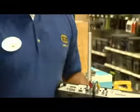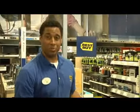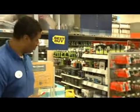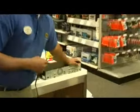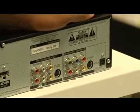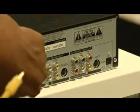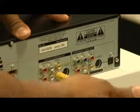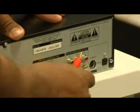After you've taken this step, you're going to then want to take the other end of your cable and hook it into the back of your VCR via the inputs. You're going to want to be careful — on the back of most VCRs there are input and output plugs, so you're going to want to locate the plug that says input. Then match those same ends: yellow to yellow, white to white, and red to red.